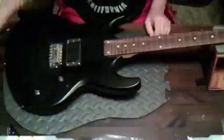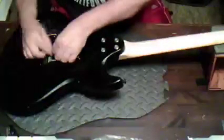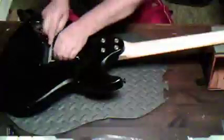Alright. Now we're cooking with gasoline, as my father used to say. So I need to take this flipper over and take the tension springs off the trim. Sorry, I bumped the microphone, folks. Okay, so you have to take these springs off, and you want to hold the string, because otherwise, if you take it off, it could go pew and just go shooting across the room. Sometimes you have to do them one at a time. Sometimes you have to stick a screwdriver under there just to make a little wedge. There we go. Kind of help it along, if you will.